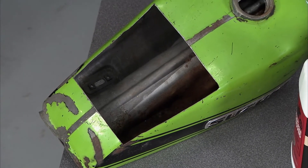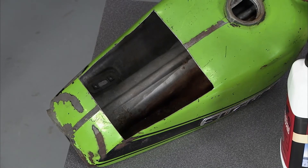A perfect example of that is the rust found in your gas tank. An easy way to clean out a tank is simply pour it out, fill it up with Metal Rescue, and let it sit for 12 to 24 hours and let it work its magic. After that time, you simply empty it out, flush it with gasoline, and now you have a rust-free gas tank. It's just that easy.